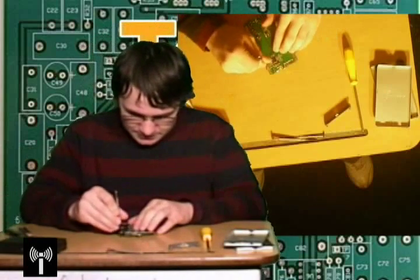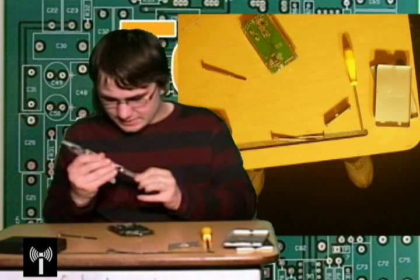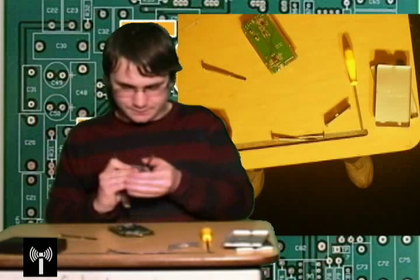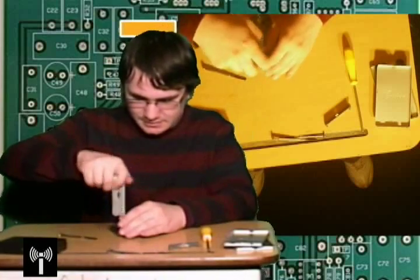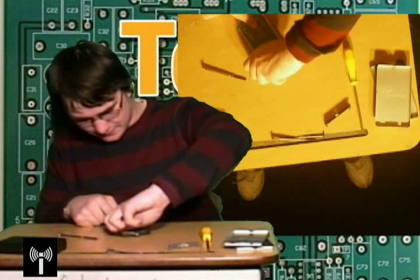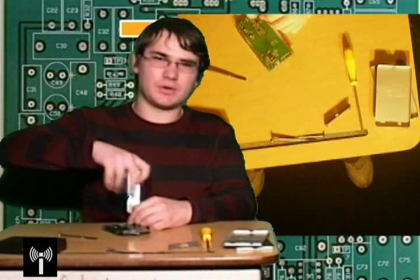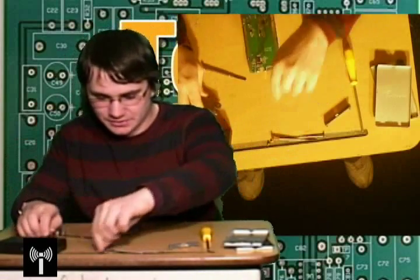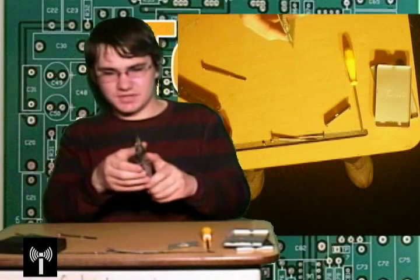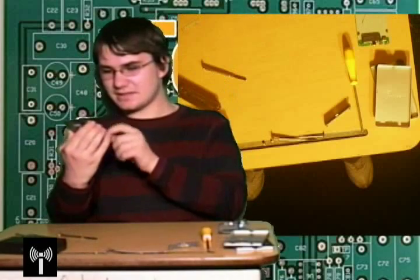Just using a screwdriver, you can remove the screws on the side. You've just got four screws around the outside — this one's only got two because I've already disassembled this once, and I'm just doing it a second time to show you. So pop the screws out. Upgrading your hard drive is actually a pretty quick procedure. Afterwards you've got to reinstall your operating system and transfer your files, but we'll disregard that for now. The actual changing of the disks is a really simple job. Once you've got the screws out, you just tug on the hard drive and out it pops. And this is the important part — a serial ATA hard drive — exactly the same as something you'd find in your laptop.